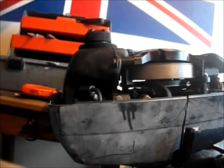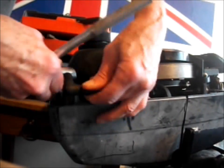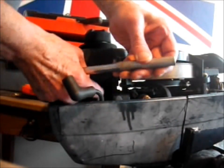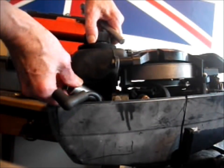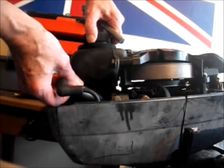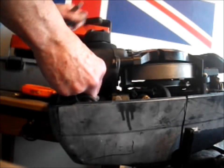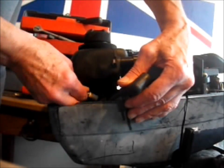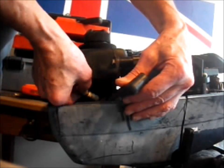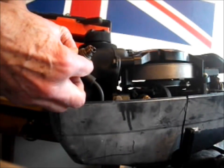As you can see, just looking over the cowl in there, which is split. But as I said before, I got it for nothing basically, so you can't look a gift horse in the mouth. I'm just taking the plugs out, which weren't very tight anyway — they were pretty much almost finger loose. Spark plugs are only finger tight with a little nip with a spanner. There are two plugs, being a twin cylinder of course. When I took the plugs out they weren't too bad at all.